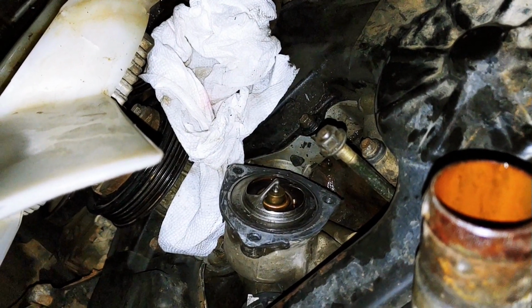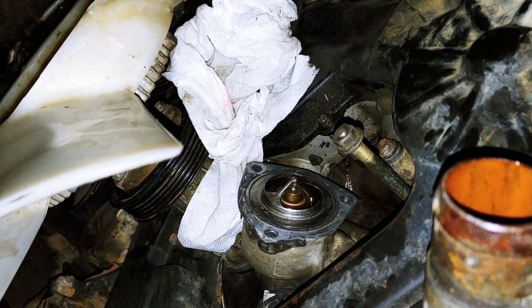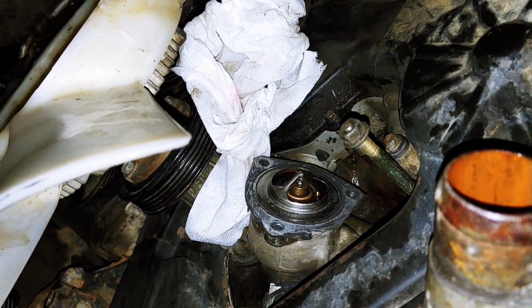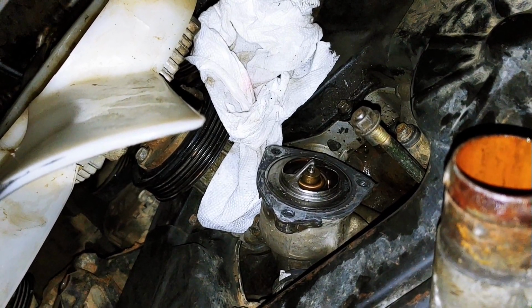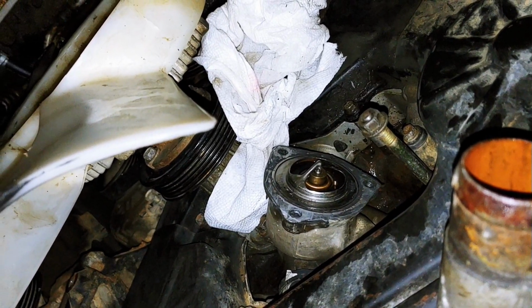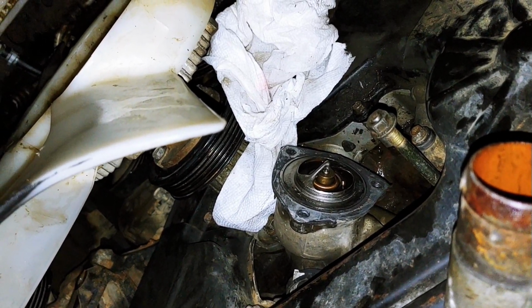But once you put the RTV on there, you assemble it immediately, and you just loosely finger tighten the hardware until it just barely starts to squish through. And then you have to wait for an hour for it to firm up a little bit before you do a final torque. If you torque it too soon, then you can squish the rest of it out, and it'll just kind of squeeze out the edges and not make a good seal.